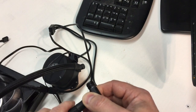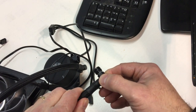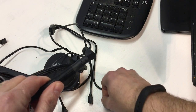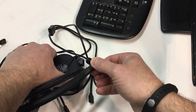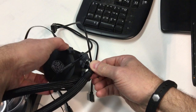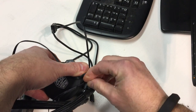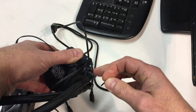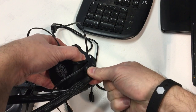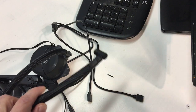Next thing to do is go ahead and refill the system with glycol — probably a 50-50 glycol-water mix. After this pushes into the pump, there is a little pin here that goes in this hole, so I have to drive that in. This pin is what locks the hose fitting to the pump. So the next thing is to get the glycol in, and then we'll check for leaks.